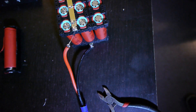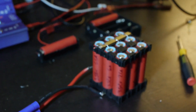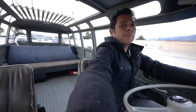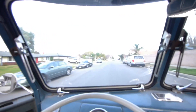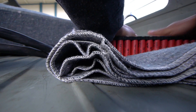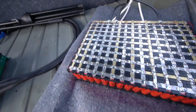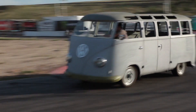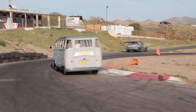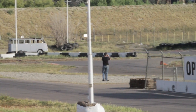The wire I tested and chose for the job proved to slowly burn up at 6 amps, which is slightly above the amperage each cell will see under normal operation pushing the Samba around. The problem is that there might not be enough headroom. But if we do the math, 6 amps times 150 cells equals 900 amps. So in theory you would have to demand 900 amps for about 10 seconds out of this module before you would start seeing fuses glow orange.